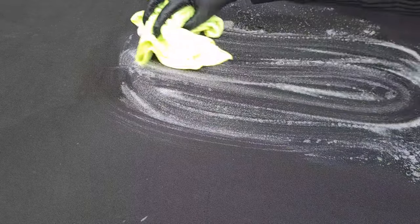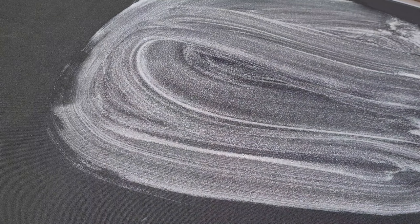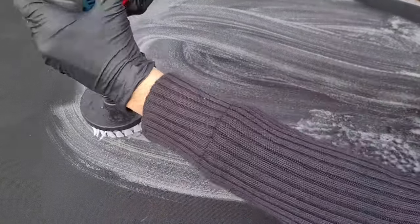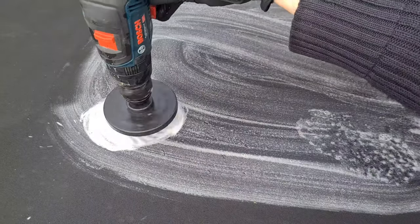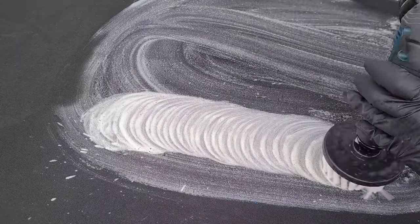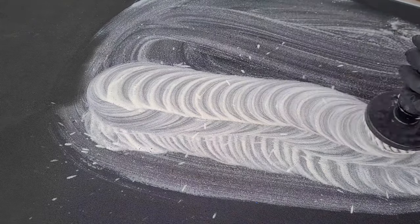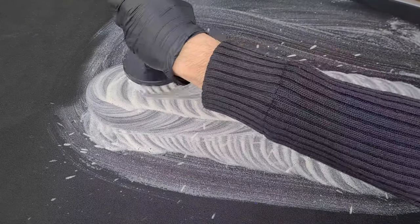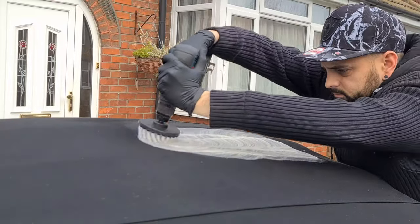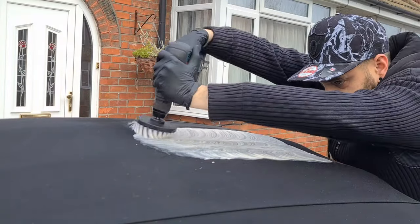For the flat tops, I wet the panel to make sure it's lubricated — it reactivates the product. I'm using the softest drill brush I have, no stiffer than a hog's hair brush, at very very low speed. I'd only recommend using the drill on the flat panels, working like you would when polishing a car — left to right and overlapping as you go.